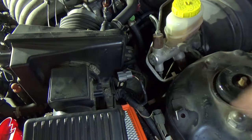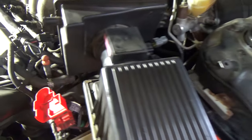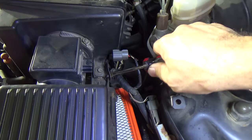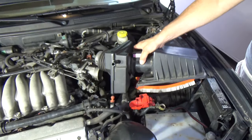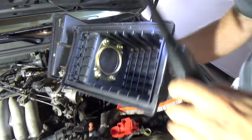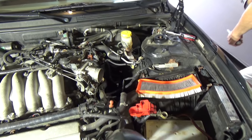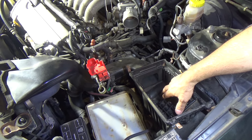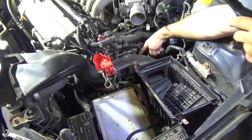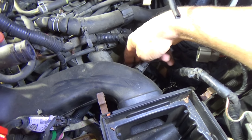You take your cat's paw or a screwdriver, get right in here and twist this out. Now go ahead and get the thing coming out nice and steady. This is the mass airflow sensor - you see the honeycomb screen right there, your mass airflow is right back past it. So if you need to clean it, that's a good time. Here's our filter. We're going to have to remove the air box, which has this tubing - we need to get this out of our way because right down in here is where our starter is.